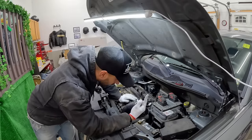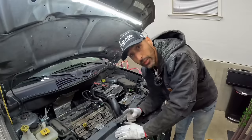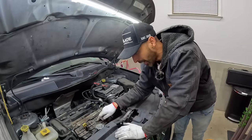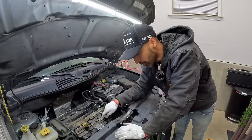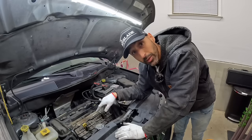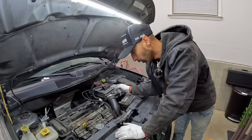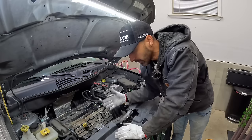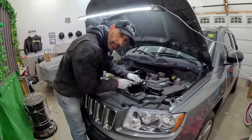The test we're gonna do is when we remove the sensor, take a screwdriver and basically move the intake back and forth to see if it moves. If it's stuck then that's a problem as well, and we'd have to change the whole piece. So let's take our bolts out.